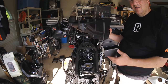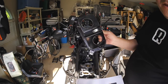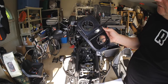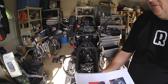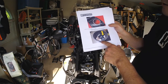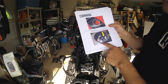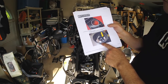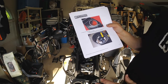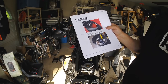Here's the air box — I'm going to box it all back up, save all the parts, put it back together again, and just store it in case I ever put the bike back to stock. The new Rottweiler pieces went in really nicely — they're all greased up, the O-rings are in place, and the air temperature sensor is in place. The Rottweiler instruction set actually says go ahead and throw that air box in the trash; they give you three choices: throw it in the trash, mail it back to KTM and ask them to fire the engineer, or burn it for warmth because it left you stranded. We're just going to keep it and maybe reuse it for something else.